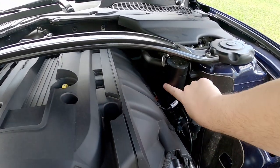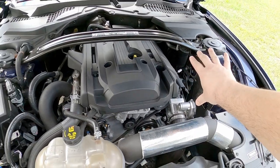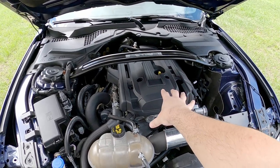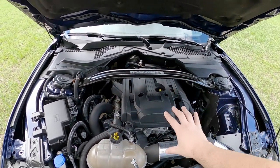The car has approximately 30-some thousand miles. I drive it a lot. The good thing is I've had the Mishimoto catch can on since around seven or eight thousand miles — it's been on for a long time. Unfortunately that's not going to be 100% effective at pulling all the oil vapor away from going back onto the backs of the valves. And of course there's all the mileage that accrued before I put the catch can on, so I'm sure there's probably a little bit of build-up on the backs of the valves.